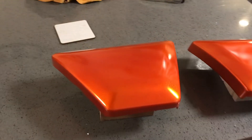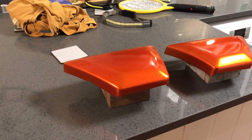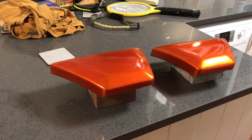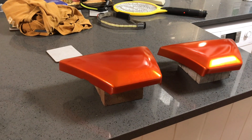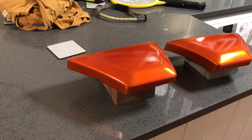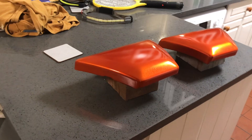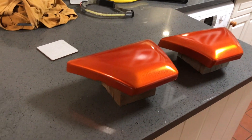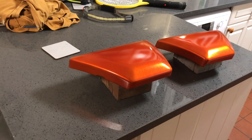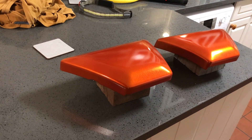I brought these in to cure. The way of doing this is you put your silver base coat on and then give a very light spray with the Bombay Orange, which doesn't have a lot of pigment in it as I mentioned before. So don't be tempted when spraying the panels to try to get it to be the colour you're looking for because you'll not do it - you'll get runs. Keep doing coats; once the silver base coat is fully covered, proceed carefully and add coat after coat, but you have to keep checking with the bike. If you under-do it the panels will be too light in colour; if you overdo it they'll get darker than the fuel tank.